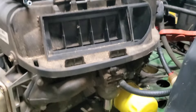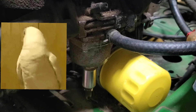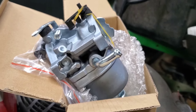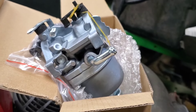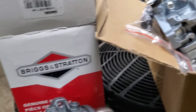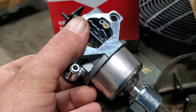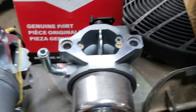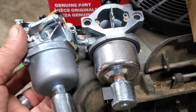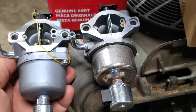Let's talk about your carburetors. Look up the part number — if it's got a Nikki on there, throw it in the trash. You can get a Chinese one for $20, or order an OEM Briggs and you're going to get a Walbro-style carburetor, which in my opinion is way better. Sometimes the customer wants the $20 aftermarket — customer's always right, mostly.